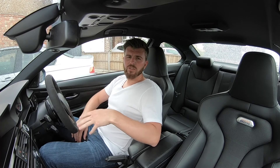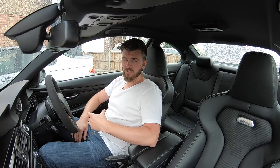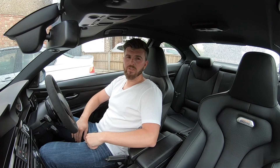If you've got an LCI car — the facelift — this process is going to be a little bit easier because under the seats there is a module that controls the heated seats and all the memory effect. Unfortunately on pre-facelift cars, if you look under your seats and you've got a black module, it's not going to work. They'll power up for 10 seconds, then fault and won't work with the canbus correctly.